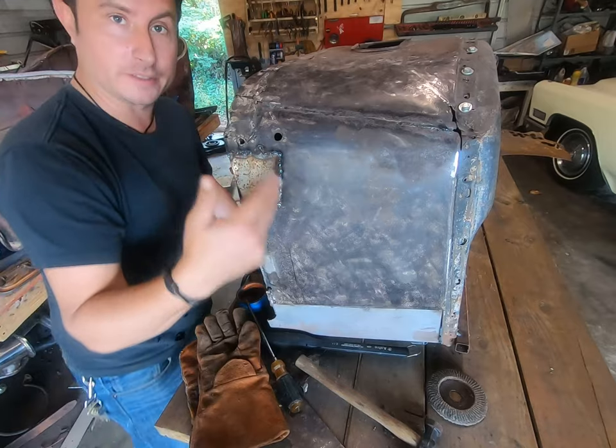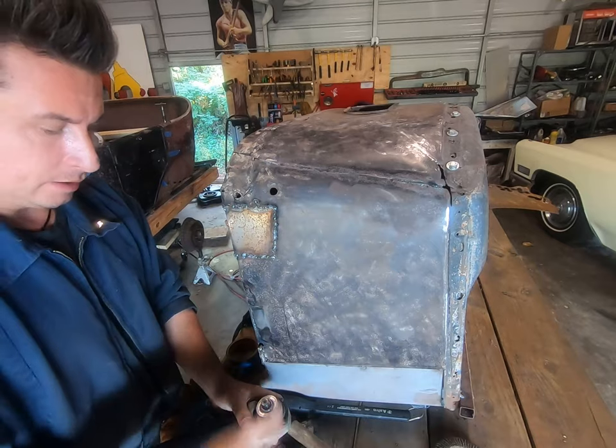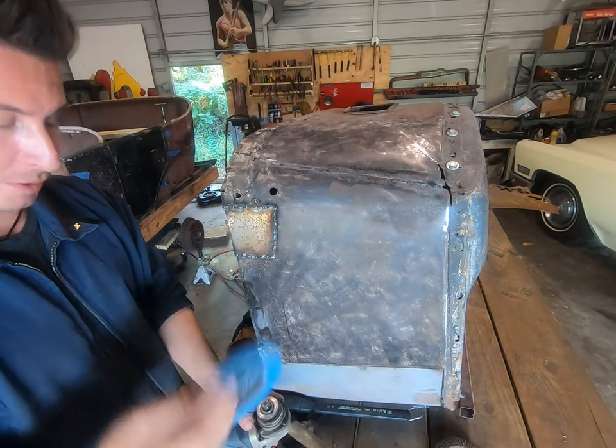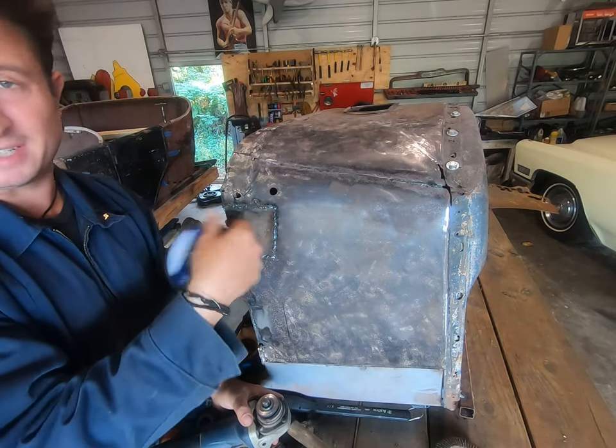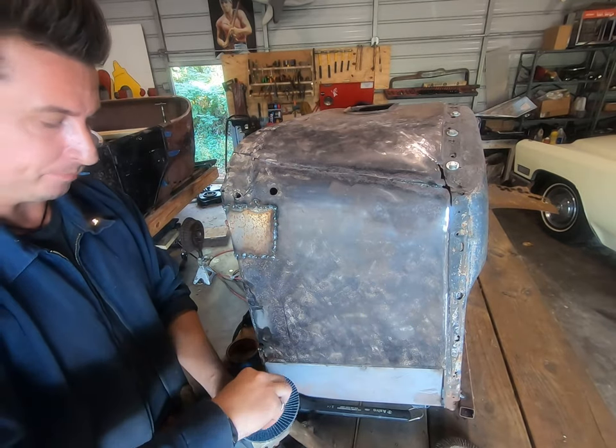Let's hit it with a grinder and see what we really got after all of this ugliness that no one shows you. Let's go ahead and take a flat wheel to it, which is the ultimate secret to internet metal finish, and then take a look at how we really did and assess.